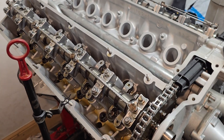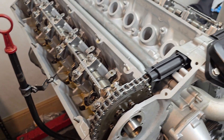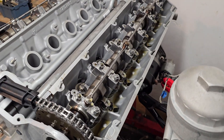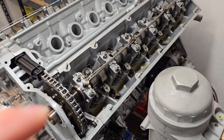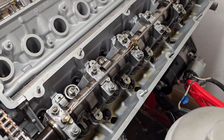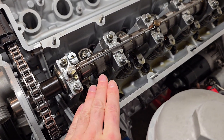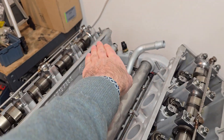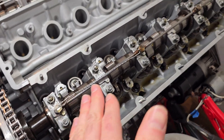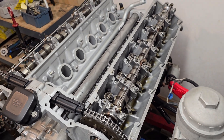As you can see, there's absolutely no issue with this engine generating oil pressure — the oil pump is working perfectly. Obviously when the engine is running under its own power it's spinning many many times faster, oil pressure builds instantly, it doesn't take the guts of 10 seconds to get going — you'll see oil at the top of the engine within one to two seconds. There's a slight reduction in pressure at this end of this cam and at this end of this cam, essentially because the starter motor can't spin the engine fast enough to generate full pressure all the way along each camshaft.